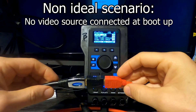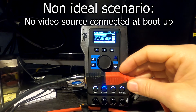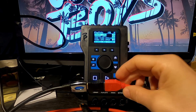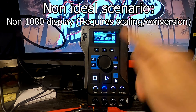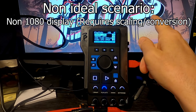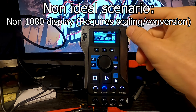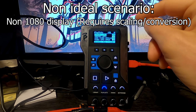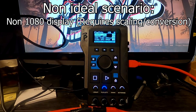Doing a quick restart, you can see the logo up and I've got my holding screen. So if you're in a situation where you don't have a chance to connect video early, get all your audio set up and then do the reboot. If we detach the display it would go off, but that should re-establish when we plug back in — give the display a few seconds and there we go. Now another situation you might encounter is if the display isn't 1920x1080; certain festivals may use different resolution screens.